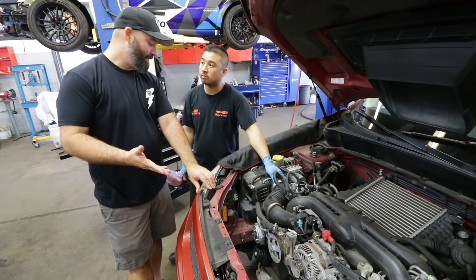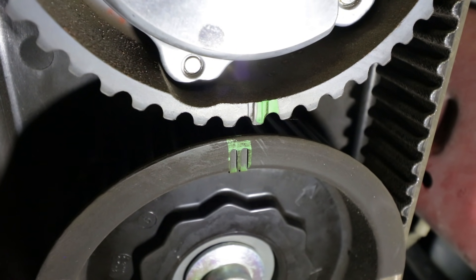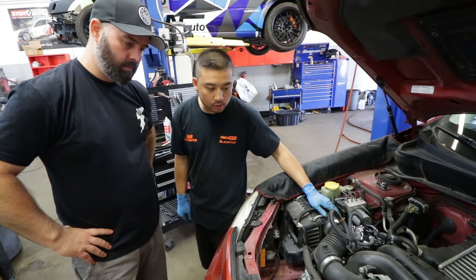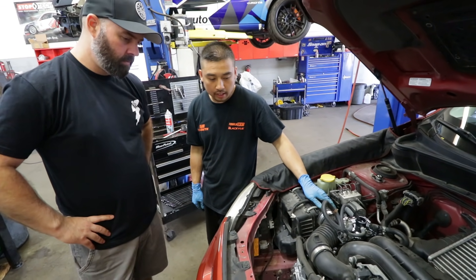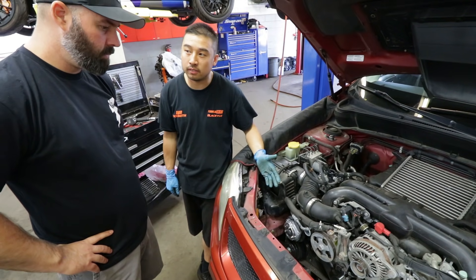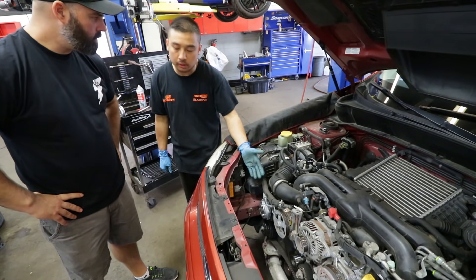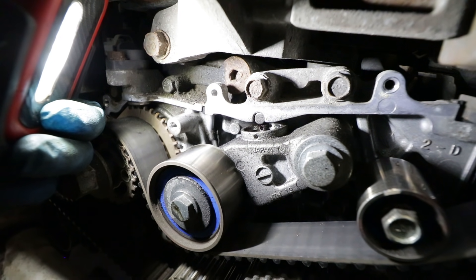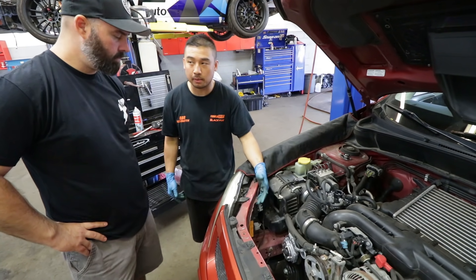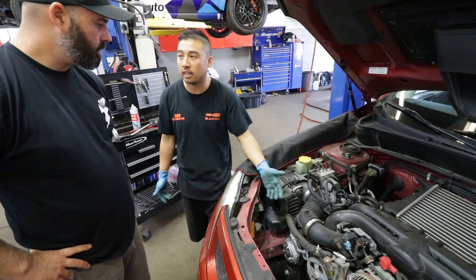An interesting discovery here: the crank is in the right position but the cams are not lining up. That means either the belt has stretched or the timing has jumped a tooth — and this is why it's so important to change the timing belt and tensioner at proper intervals. You can also see the hydraulic tensioner is wet at the top, which means it's leaking and not holding proper tension. At about 170,000 kilometers, the belt's probably stretched beyond its limit.